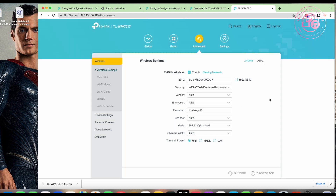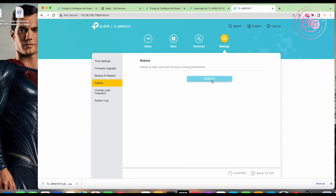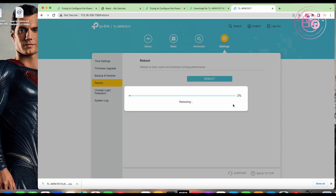Once configured, when I click to view all available networks I should now only see 'SMJ Media Group' — no TP-Link network anymore. It should now resolve as one whole network. When I move between rooms, my phone will automatically connect to the strongest access point because the profile stored is exactly the same as my router's. It should hop over quickly and connect seamlessly.